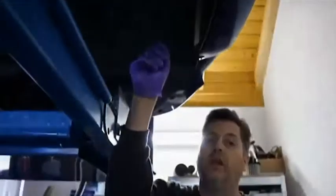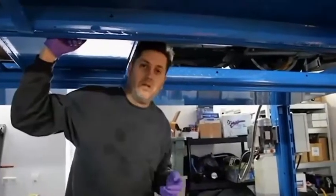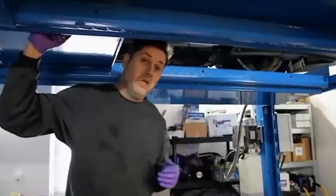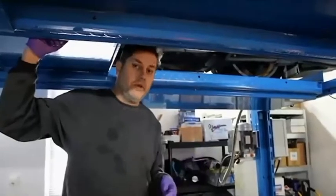This is the oil cooler in the lower front. It's a perfect placement for cooling, not so perfect for damage and possible problems. The hoses from the oil cooler are slightly higher than the oil pan, which means oil will stay in the oil cooler even though you drain the oil. This basic oil change procedure holds true not just if you have an M5, but for most cars. Oil filters are typically located on the bottom. Some European cars have the oil filters located in the top portion, in which case you'll have to pop the hood and change the filter from the top.